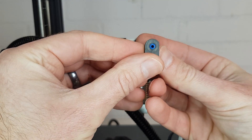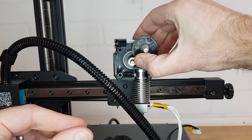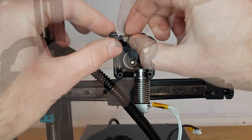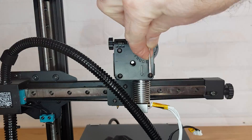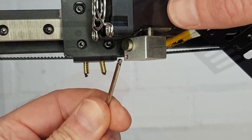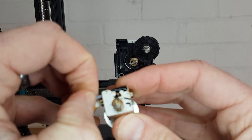You may want to wait until you've fully reassembled everything before final tightening your nozzle. Push the hotend back into position and then reinstall the plastic spacer with the curved section towards the back. First just check that the PTFE lining is still in position inside. Slide the extruder lever back on and then reinstall the spring and adjuster before reinstalling the cover. Before attaching the fan cover just check that your thermistor is in the right place — it shouldn't be protruding from the heat block. Instead it should sit right in the middle of the heat block to accurately measure the temperatures; slide yours back if it's in the wrong place.